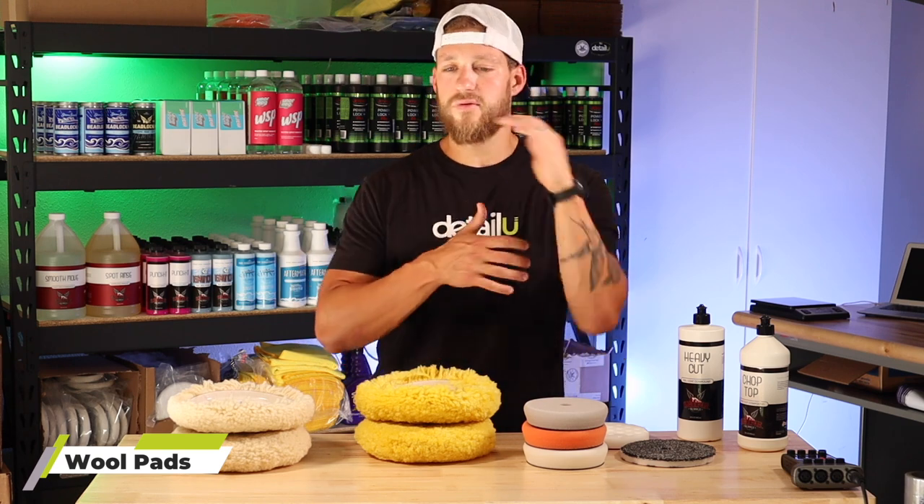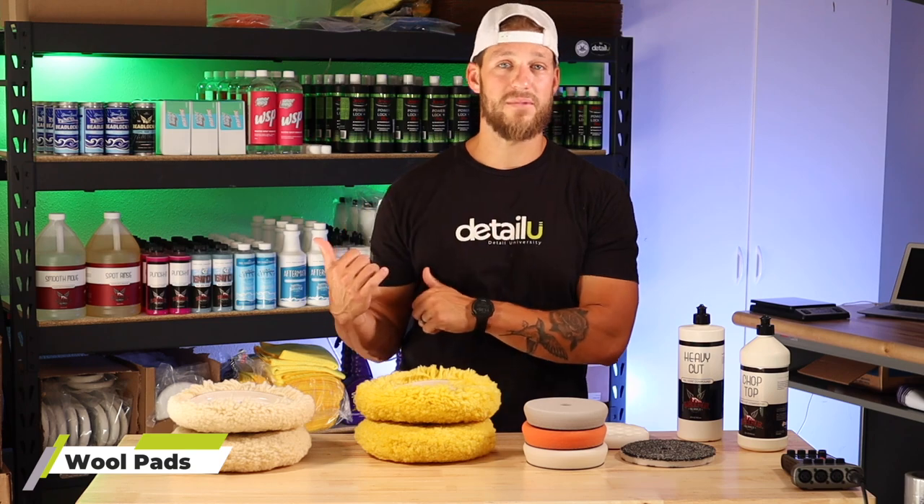In the last pads video I made a couple of years ago, I basically said this pad was irrelevant — I do not believe that anymore. I used to do most of my heavy cutting with the force rotation polisher, but over the last two years I've learned that I really enjoy more rotary compounding than force rotation, because force rotation actually takes a lot of concentration, pressure, and arm speed. Whereas with the rotary, if you do more rotary steps, you can do less polishing overall, making it easier on bigger boats like yachts or houseboats. When you're doing smaller boats, force rotations come in super handy, so you don't want to get rid of them completely.